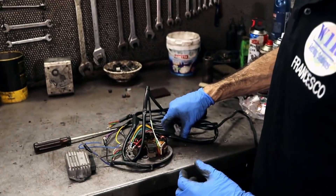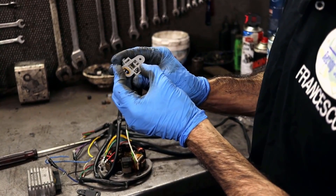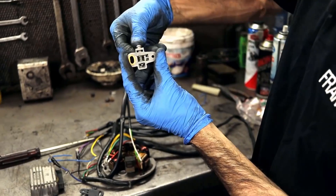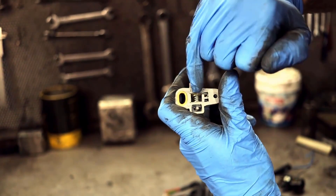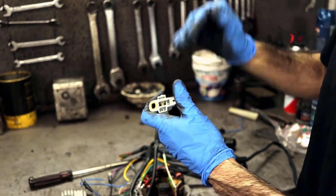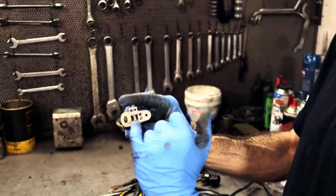Let's get to the stop. You have to change the stop switch — you need to get one which makes the pedal stop circuit open in the rest position. When the pedal is at rest, this button is pressed: you see that contact is not made there. Contact is made when the stop pedal is pressed and the button is released, and thus the circuit closes. The original one works the other way around, because the circuit must be closed with the pedal at rest so that the relative coil is short-circuited. We have the opposite need, but replacing the switch is not enough — you need to make a small modification to the system and connect the wires from the new switch to either tab.